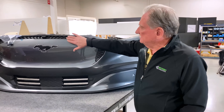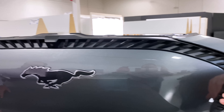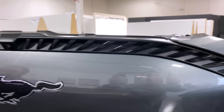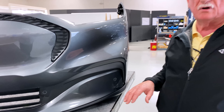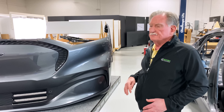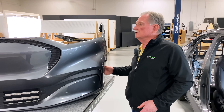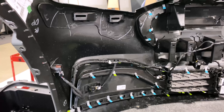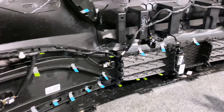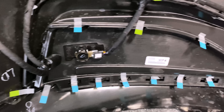The other thing is that there's a lot of styling cues on here, and you'll notice that the fascia has been bright painted, coming right out of the mold. These apertures or accent points are something that usually turn into a big problem. If you mask them during painting, it's really expensive. If you put them on as an afterthought, you get a lot of nuts and bolts and screws. But let's have a look at what Ford did here with snap fits. Everywhere you see one of these little tags — we just split it down the middle — those are snap fits holding those components together. No screws. The operator will just push or tap with the palm of their hand and snap, snap, snap, and it's in.